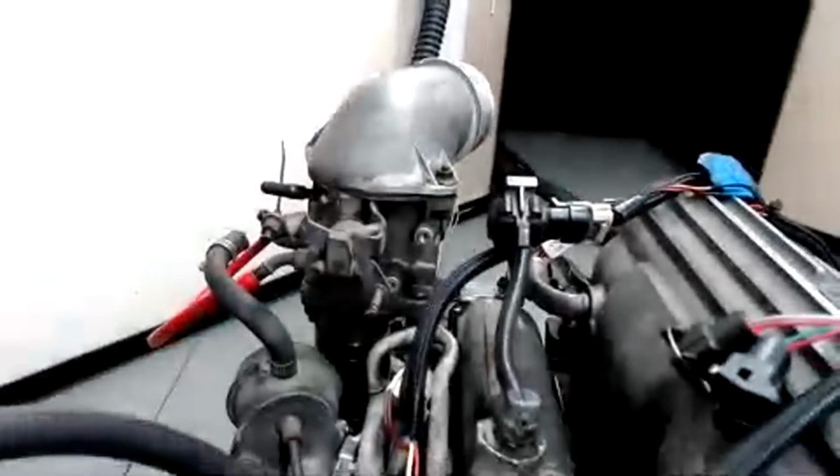And we actually ran it on E85. See, it's got the draw-through throttle body, the log style manifold, and a factory turbo on there. But the cool thing is we ran it. It has oil pressure, like 60 or more pounds. First, we started it up just running it on brake clean, which was awesome since we had a crank signal, and the distributor worked out fantastic. Then we hooked up the fuel injectors and Ish did this magic tune on the 4-cylinder deal, and that thing started up. So it is a runner, which is good.